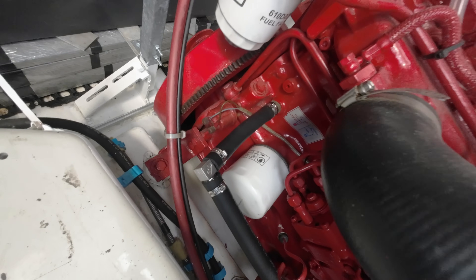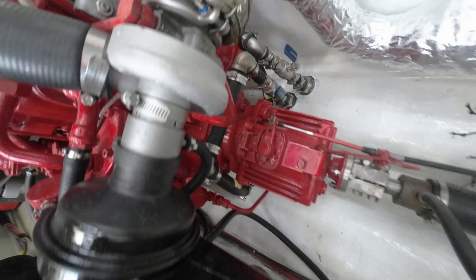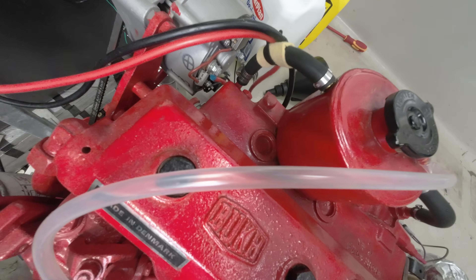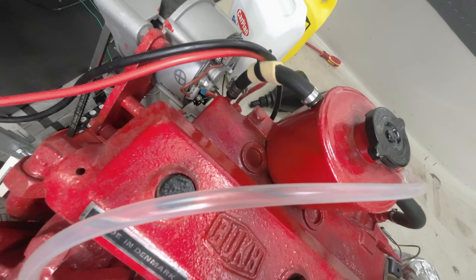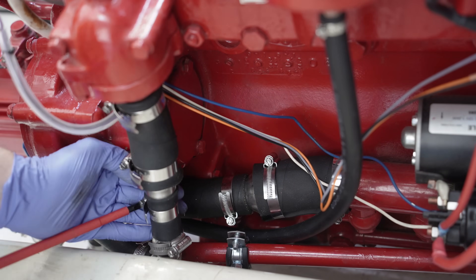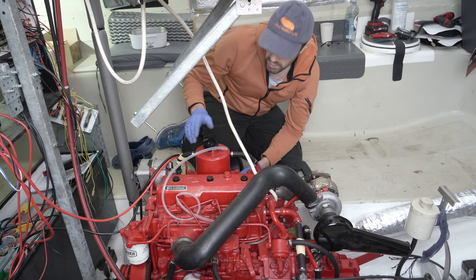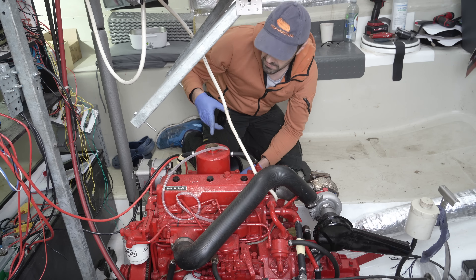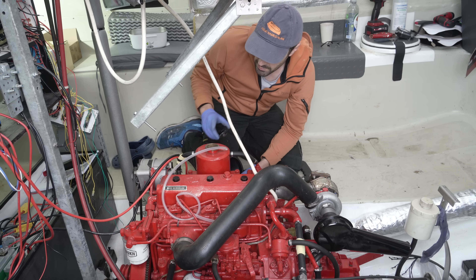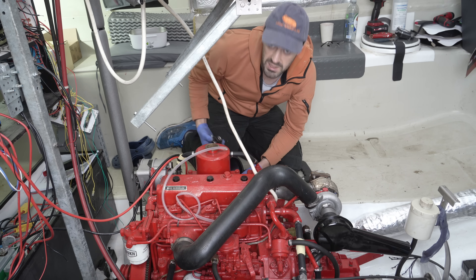Back inside, I felt ready to be unleashed from this complex multi-week job, but first, I did a once-over. This would not be the time to realise that I'd missed an entire outlet, or forgotten a clip. I hadn't, but I did go around each and every clip once again to re-tighten. After a few days, it seems the rubber in the hoses beds in, and can then take a little more tightening, but I'm still only going to the point of hand-tight with a screwdriver. I had a good look inside the header tank, and there were a couple of little flakes of paint which I've managed to scoop out, but I'm going to have to trust that there's not more gunk or obstruction stuck in the system. There were no particular problems when I was running the engine before, so I've got no reason to expect a big problem now.